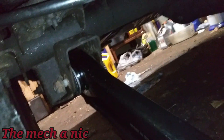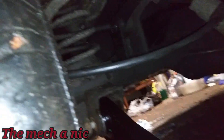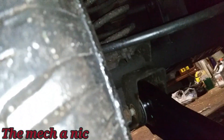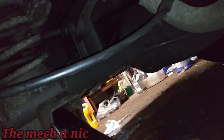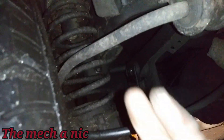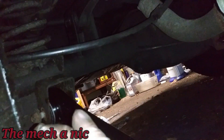I need all of this aligned, so very loosely I put that bolt in back there. Looking at the rear differential, if I were to jack it up from the body without supporting the differential, it looks like it might just want to fall right out — the spring may come out. It's the upper arm and the lower arm that hold everything in place, but with only the upper arm installed, the rear end may want to fall down and the spring pop out the second you lift up the body. So I'm not going to make that stupid mistake.